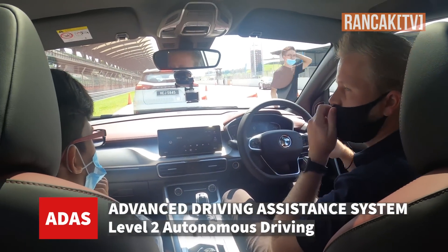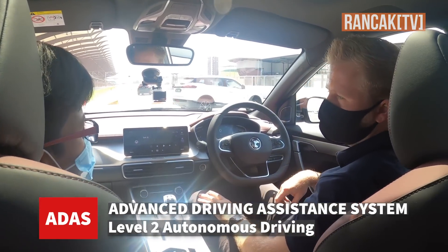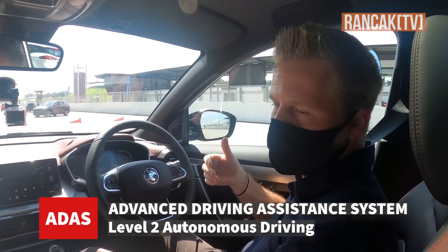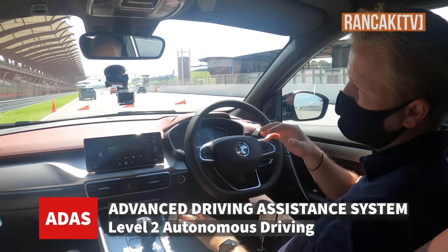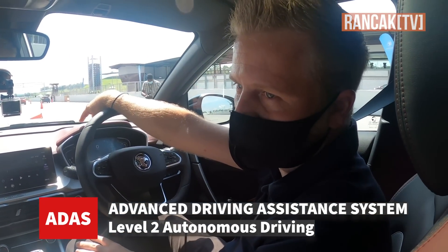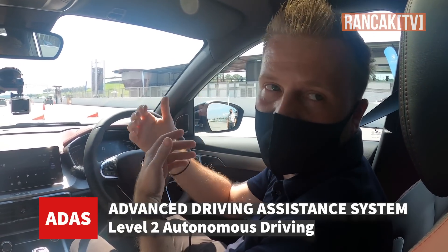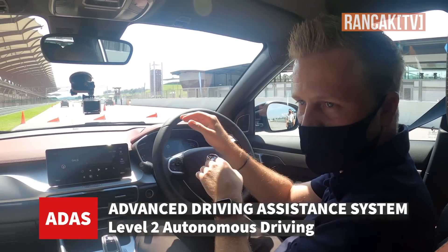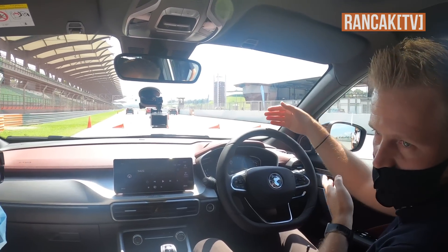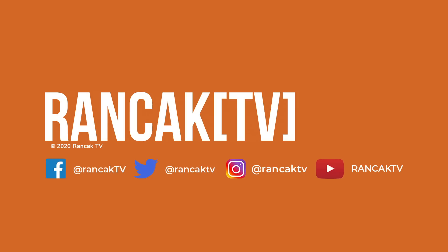Does all level 2 autonomous driving assistance have this kind of feature? In other brands — not sure about all, but some do, yes for sure. That's the idea of level 2: it has more features than level 1 and makes driving a bit easier. The main difference between level 1 and level 2 is the camera up here — it uses two systems. The radar on the front, which the X70 has as level 1, senses distance and gives you AEB, forward collision warning, and adaptive cruise control. But with the extra camera, the advantage is that it can come to a complete stop, go through quite sharp corners, and has more features that way.